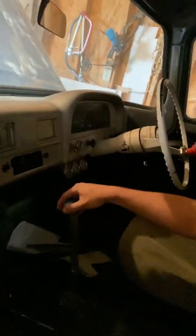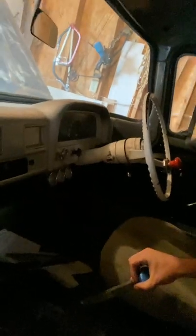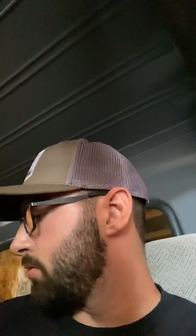I don't actually know if this is standard for dirt track cars, but it does have a 2-speed Powerglide in it. So it's just reverse, neutral, high and low, or 1 and 2, whatever you want to consider it to be. It does work pretty well, in all honesty. And then it has a 3500 stall torque converter. So I'd like to go to maybe a little bit lower stall torque converter, and then maybe a 3-speed Powerglide with a setup that actually looks a lot better than this, hopefully a ratchet shifter system.